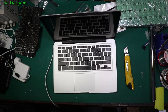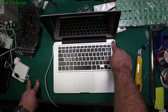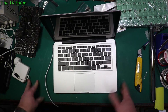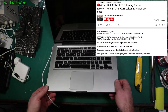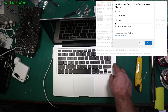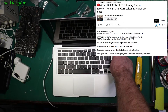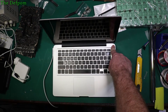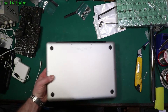Have a green light, no orange light, so even though there's no battery or the battery's no good. That is a bad RAM sound. That's bad RAM. Most likely bad RAM. So that may not be much of an issue. Let's open it up and have a little look, see what's going on in there.